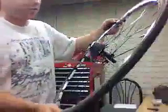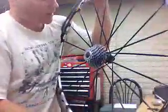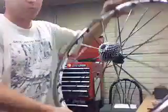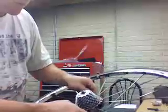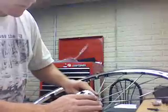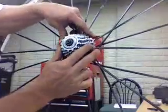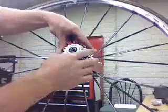I'm going to show you how to diagnose a Mavic freehub body issue and how to take one apart, clean it, and replace one. I get a lot of hits on my blog and requests for my podcast, so I figured I'd show you via video. The way you can tell it's going bad is that you grab hold of the whole cassette and move it back and forth — the more wear there is, the more movement there's going to be. The whole cassette is rocking, not just individual cogs.